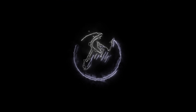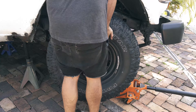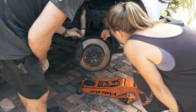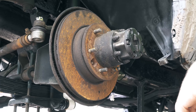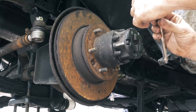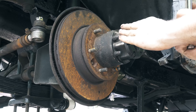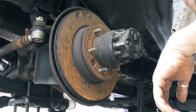So all of this has to come off somehow — I'm not exactly sure how it comes off. The first thing we want to do is get the locking hub off. You use a 10 millimeter socket, and it's probably more effective to use an impact gun when this is off, but I don't have the right attachment for my impact right now, so I'm just going to use this ratchet.